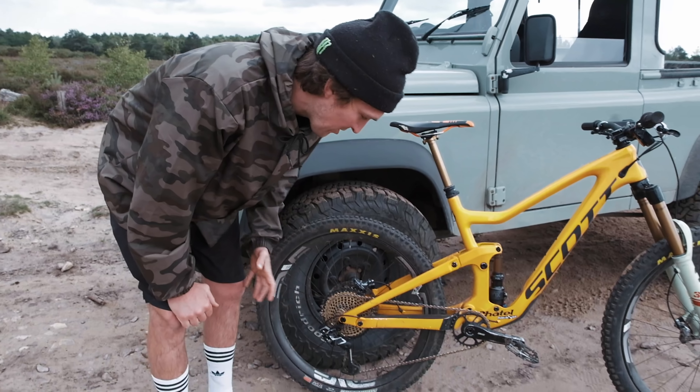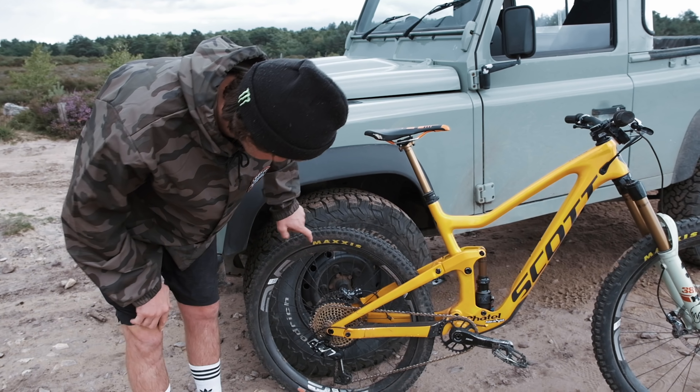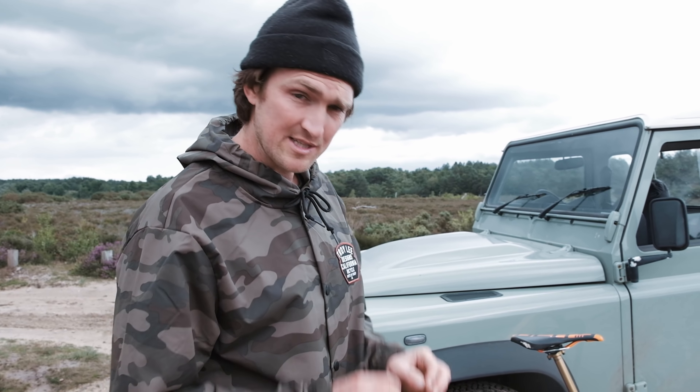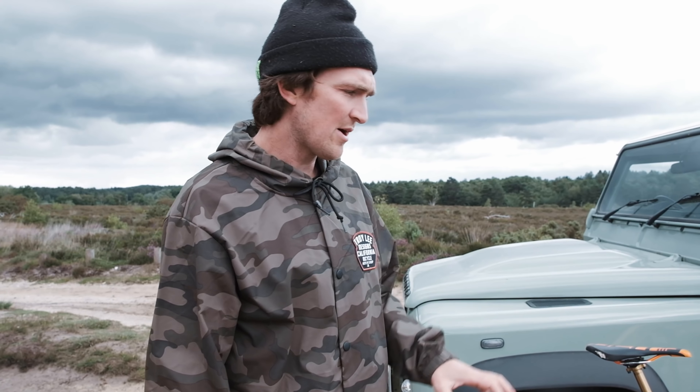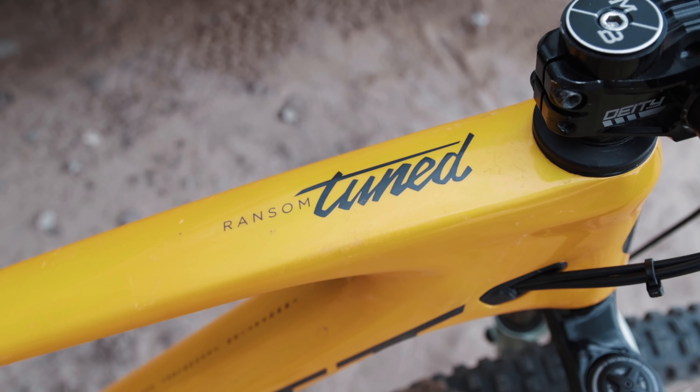Out back, NVM9 — big bulky bulletproof rim — with another Bourbon Chris King hub. In summer I run a Maxxis Aggressor Double Down at the rear, slightly thicker compound so it prevents the tire moving too much in corners, at about 30 psi. So the summer setup is DHR at the front, Aggressor at the back. The bike stays exactly the same in summer; in winter I just put Maxxis Shorties on front and back. That's the bike of choice — I go into the garage and I'm magneted straight to the Ransom every time.